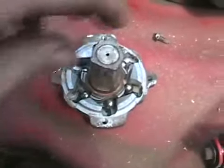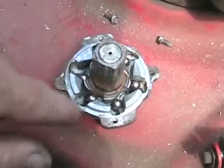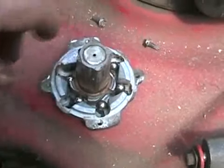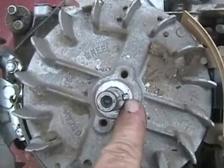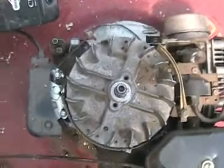This part has ball bearings in it. Never oil or grease them, just make sure the pockets are clean. If you put oil or grease in there, the bearings stick on the end and then the thing doesn't catch when you're pulling. Well, now that I've got everything off, I can see that the flywheel key is in perfect condition, so now I can put it back together and continue to see what's wrong with it.